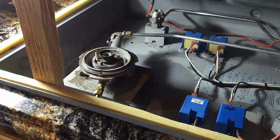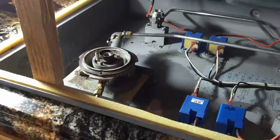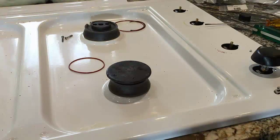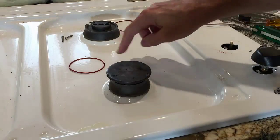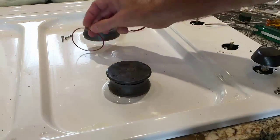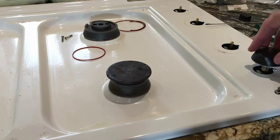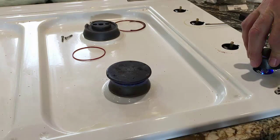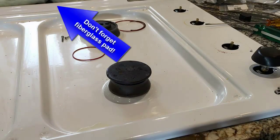As we button it up, we'll also put in these new O-rings around each of the burners. Time for the test — all plugged in. This O-ring was replaced — a little bit tricky; they don't quite stay in super good, but I think I got it under there pretty well. The other one was totally hard. And we have ignition — very good, so that all works. But I see I forgot to put that back in, so I'm going to open it up again.